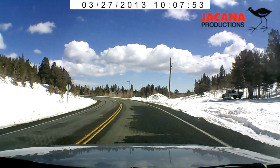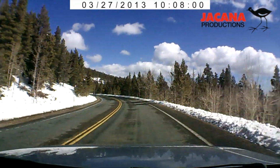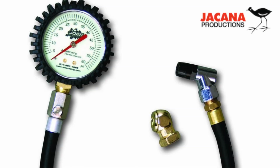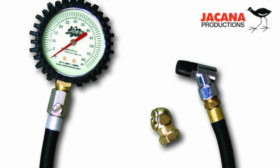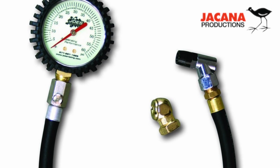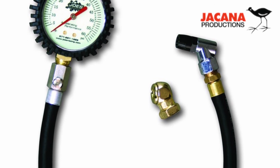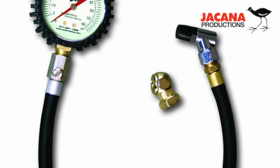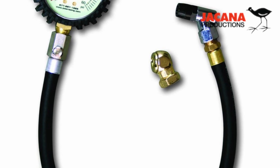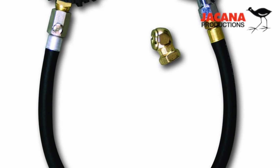Now, there's a couple of caveats that come with this. Number one, you are probably going to need one of these. Let me just drag this over here. It's a tire pressure gauge, and it's off Amazon, one of these manual ones. It's Joe's Racing, $19, a manual tire pressure gauge. The thing I like about it is it has a little button on the top that lets the air out. So what you're going to do is let the air out, see what the tire pressure is, and let maybe 5 or 7 psi out of your tires, and that's going to give you extra traction.